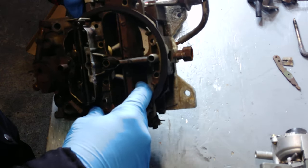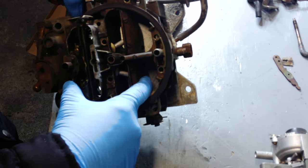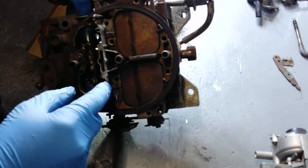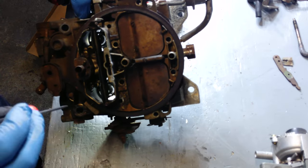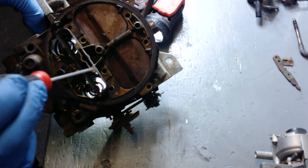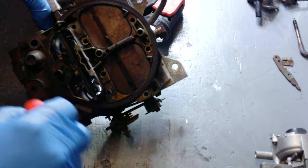The other manufacturers got the 800 as the luxury carburetor. The way GM limited it was with the secondaries — on the Caddy carbs the secondaries go almost 90 degrees, which is full CFM. You'll get a lot of these where they won't go past maybe three-quarters or not even, and we can modify that in the hat, which I'll show you in a later video. I'll also show you this 750 which came on a '79 Camaro.